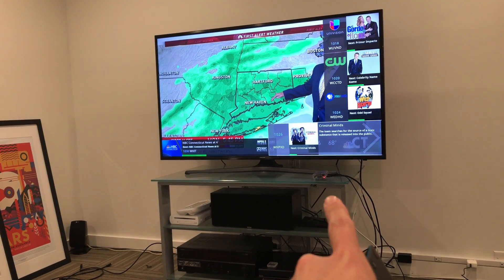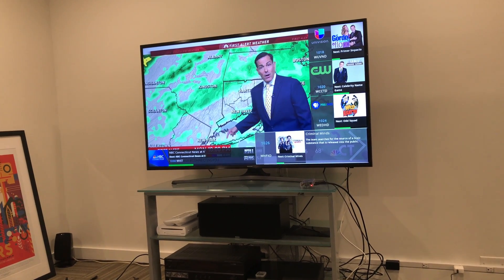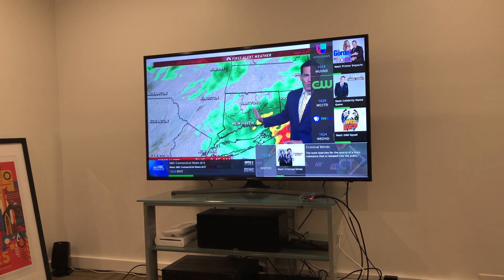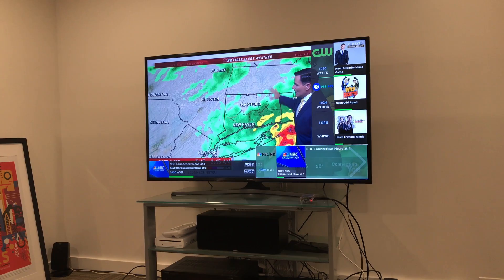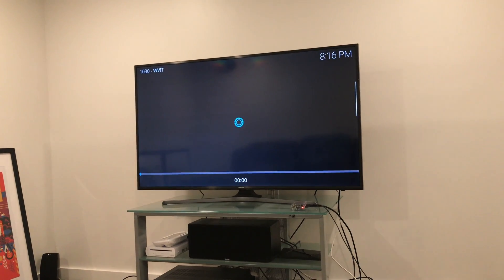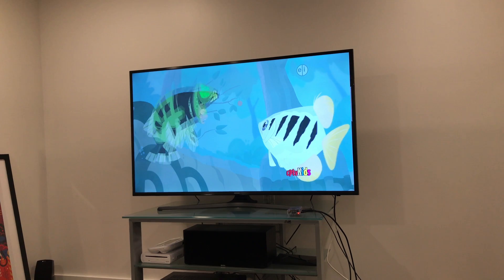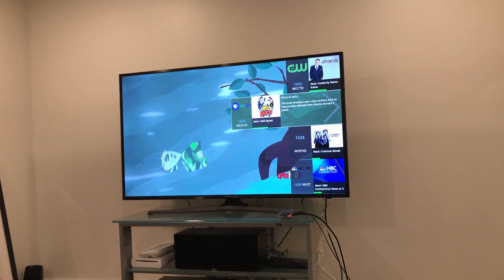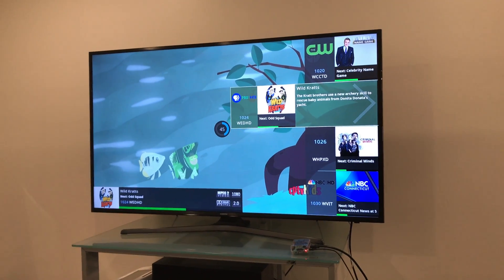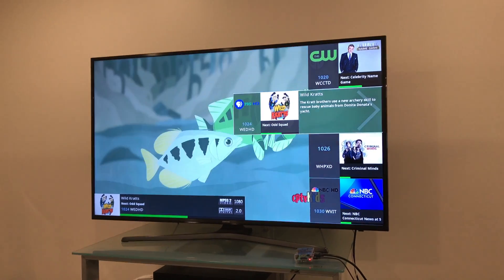One thing I'm noticing though — I have it working over Wi-Fi right now. Wi-Fi really is not the ideal scenario here, especially if you're pulling in over-the-air broadcast. This station is one my cable system doesn't convert to MPEG-4, so it's essentially just like pulling it down over the air. I'm starting to see some delays, slowdowns, and jitteriness that I wasn't getting with the device hooked up via Ethernet. You can see right now we're already rebuffering this station, just having a hard time keeping up with the Wi-Fi.